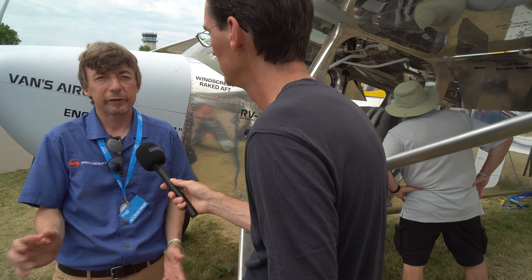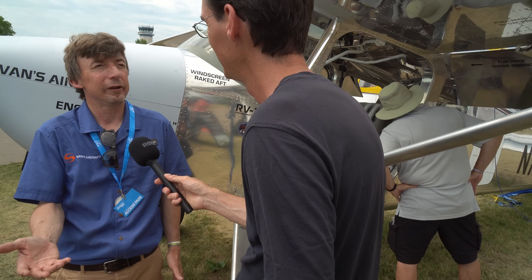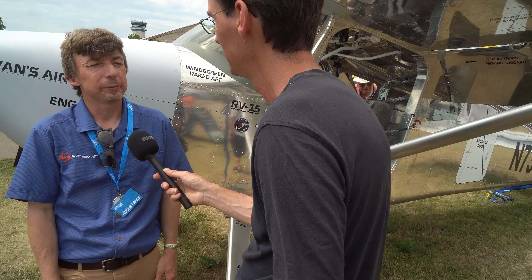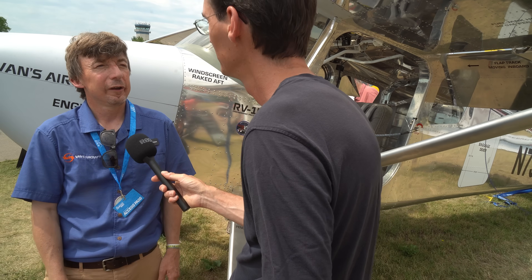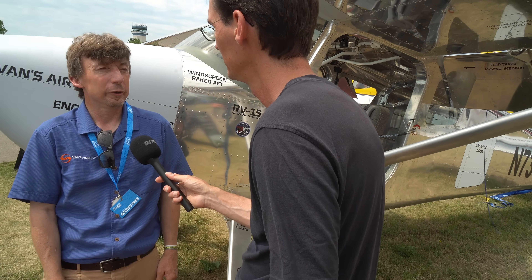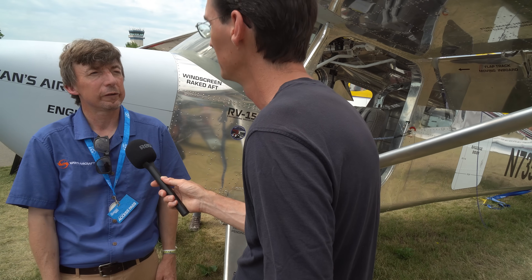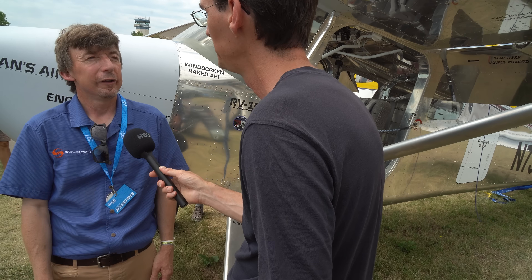The only number we're not telling you is the stall speed. We know Axel had a 140-foot landing and around a 200-foot takeoff in this airplane with the 390 engine, so the airplane's flying beautifully. We're still aiming at a 900-pound useful load. We're seeing speeds in the 130s right now on the 6x6 tires, and we hope to get over 140 with wheel pants once we've cleaned things up — this airplane still has a lot of aerodynamic deficiencies.